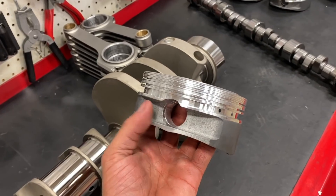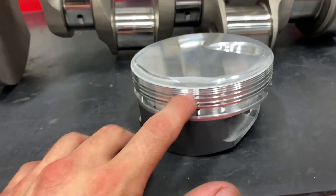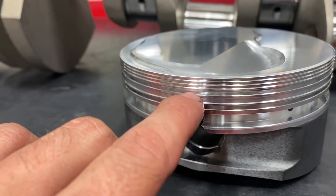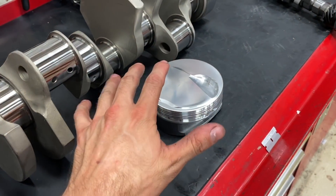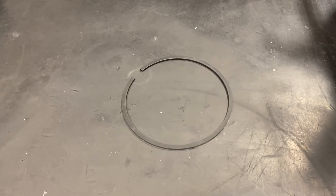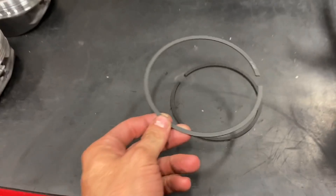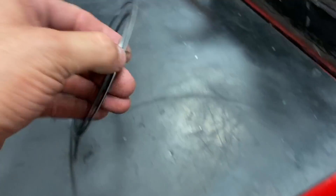The pistons feature a 2618 alloy aluminum, which is very high strength and crack resistant. They are coated, they have anti-detonation reliefs on them, massive valve reliefs for the big cam, and a super thin 0.043 top ring. Because that top ring is so thin, it's lightweight, very flexible, and can conform to the bore as the engine is running — and it's also low friction. To illustrate just how big this bore is, a four-inch bore regular small block Chevy top ring sits on the table, and the 0.043 572 ring in my hand easily fits outside of that four-inch bore.